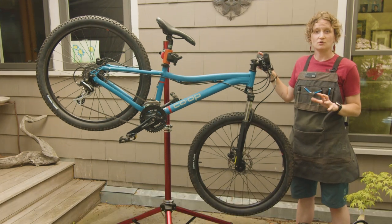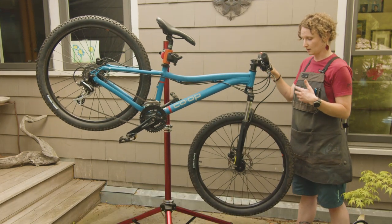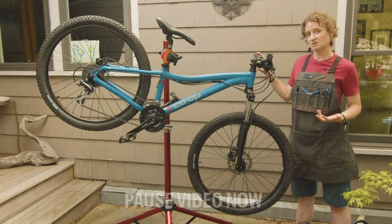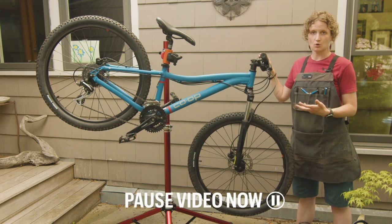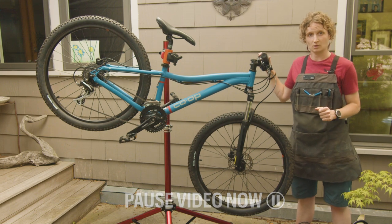So I'm actually gonna have you go ahead and pause the video so you can look at your bike and practice disengaging your rim brakes if that's what you have, and just getting to know the type of brakes that you have in case you do have to disengage those in order to get your wheel out.